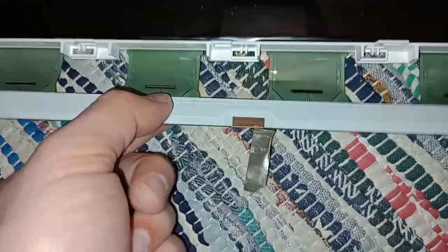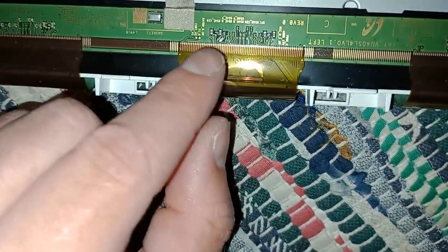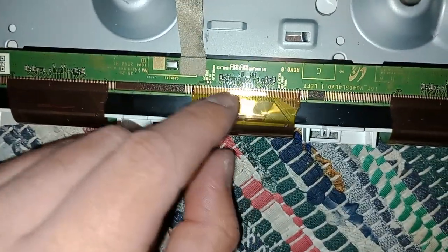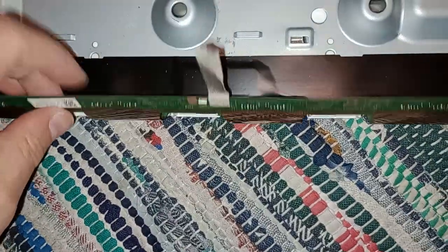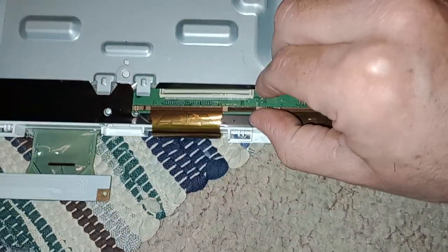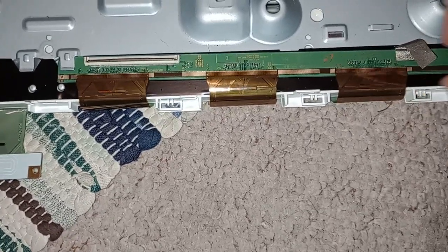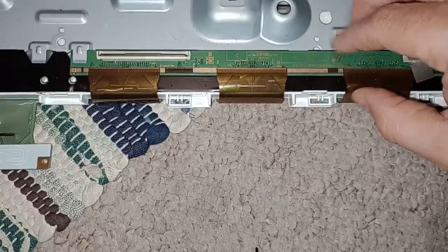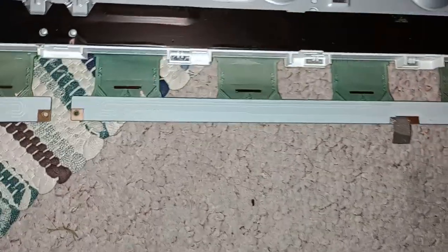These are so fragile — you can hear they're made of plastic, but they contain all the connections between the board and the LCD screen. If even one of those little bits breaks, you're going to have bits of missing picture or no picture. In this screen's case, something hit it and cracked it in a corner — a very small crack, so the screen doesn't look cracked, but it doesn't work. One side works, the other doesn't. It's sort of beyond repair, but it's a good candidate for a teardown like this.